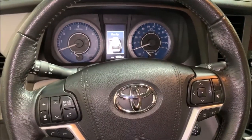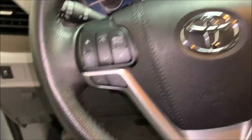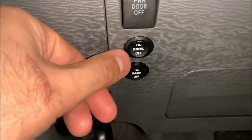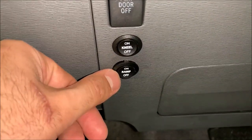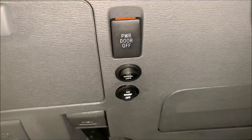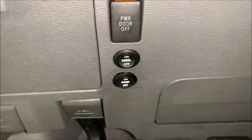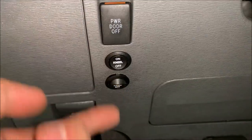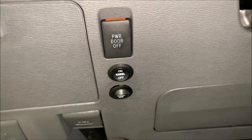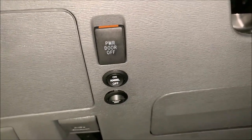There are a couple of controls up in the front driver area to control how the ramp and door operate. Right underneath here you're going to see two switches: one that says kneel on and kneel off, and the next one is ramp on and ramp off. If you switch that kneel off, the ramp system will deploy out but the car will not kneel down. If you have the ramp system switched off, then if you hit any of the passenger sliding doors to open, the door will open but the ramp system will not deploy out.